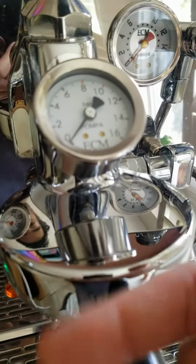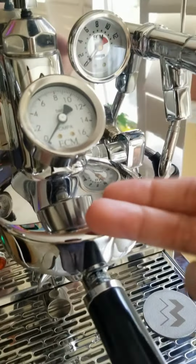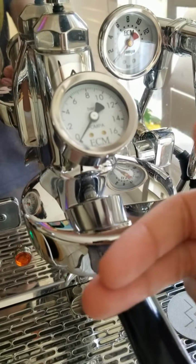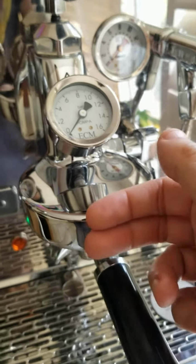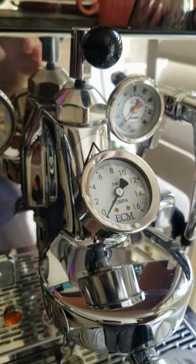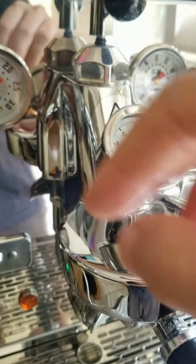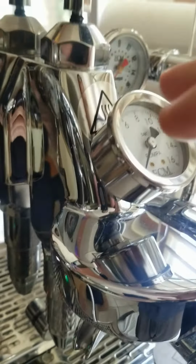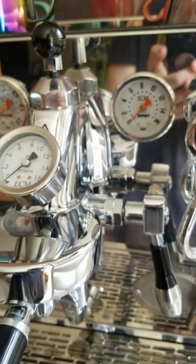The problem is this part, it should be burning hot, like I shouldn't be able to touch it, but I could touch it. It's pretty warm, but it's not hot. So this part needs to heat up, and with old-school thermodynamics, the water will heat up and steam will rise, and it siphons through there, thermosiphon, whatever. So that needs to happen sufficiently.